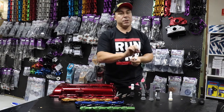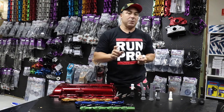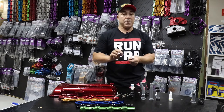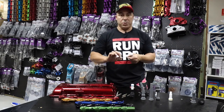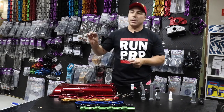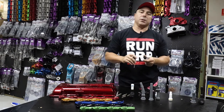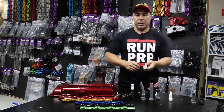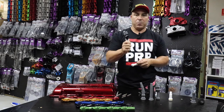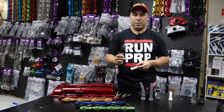The spark plug has to be a resistor spark plug to run with an R35 coil. Just because it's got an 'R' in front of the part number doesn't mean it's a resistor plug — that could merely mean it's a racing version plug. Please be very careful as to which spark plug you're using. You can end up with gremlins throughout the system — EGTs might be dropping out one at a time because you don't have a resistor spark plug. These ignition coils are designed to run with resistors, so please run resistor plugs.